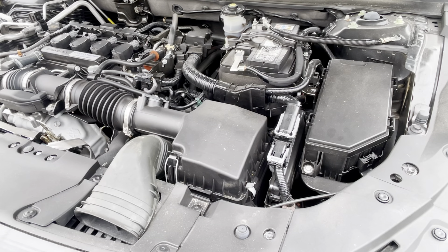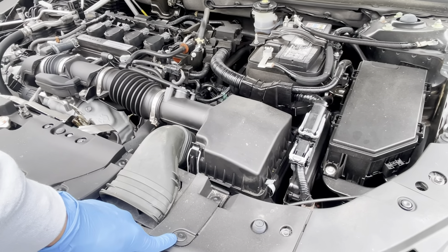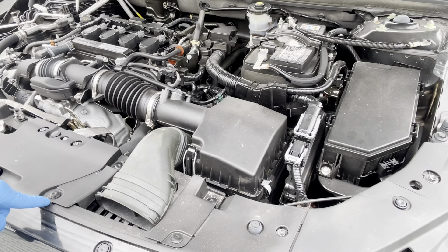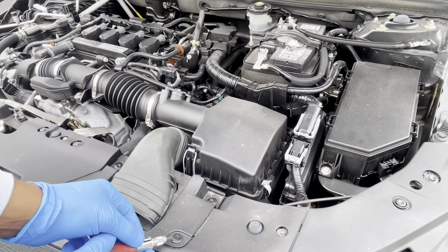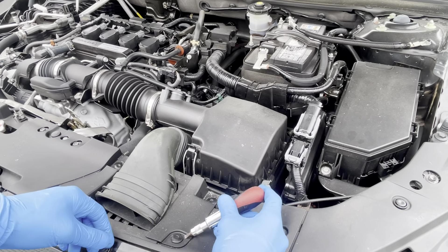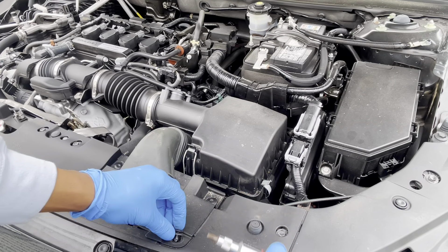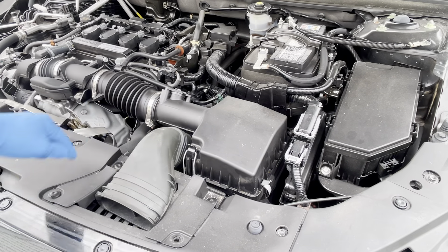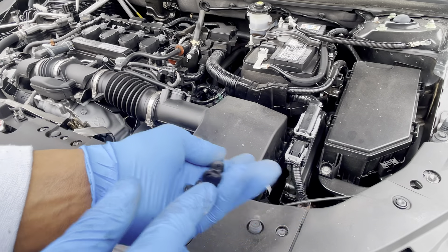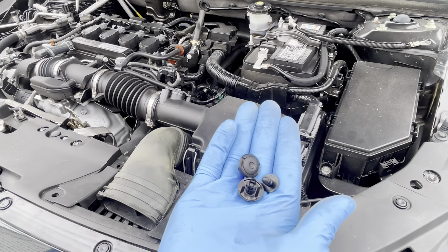On the car itself, what we're first going to do is remove these four clips right here — we got one here, one clip here, one clip here, and another one right here. We're going to take a flathead screwdriver and pry off these clips. I got the clips out. These clips do break — I actually broke this one and the one over here. They break, they're cheap. You could get them for probably like a dollar at your hardware store. After you get these off, you just pull this out and that's it.